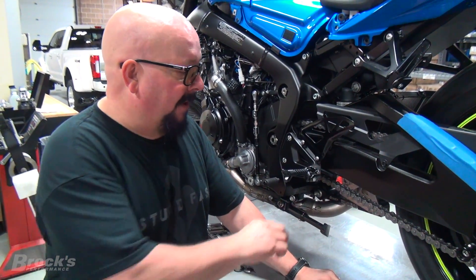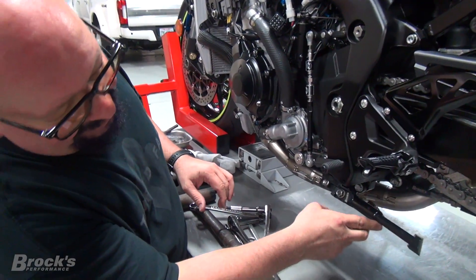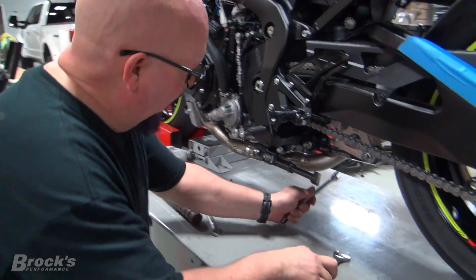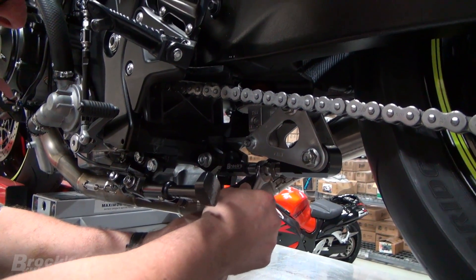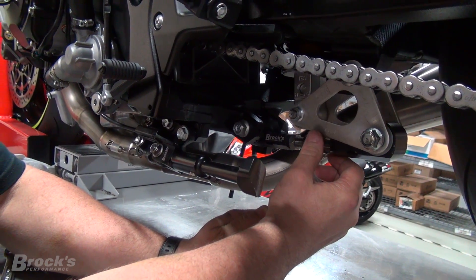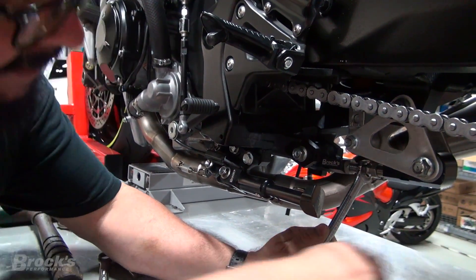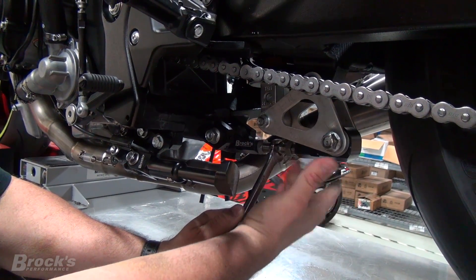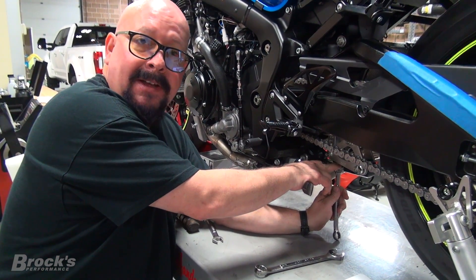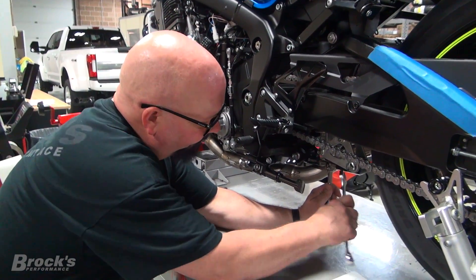I want to go ahead and tighten this up. Let's just get the kickstand out of the way - well, it's not going to get out of the way. We're going to have to adjust it - I'll get into that in detail a little bit later. We hold the stud in place - this way is loosened, so we know we want to go this way to tighten. Usually it's righty tighty, lefty loosey. Since this is a reverse thread, lefty is going to be tight. If we look at our arrow - pointing this way for loose - we're going to come this way to tighten.